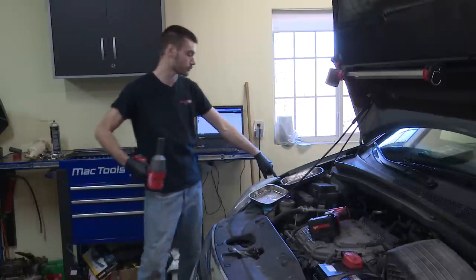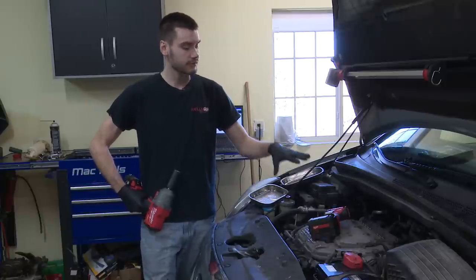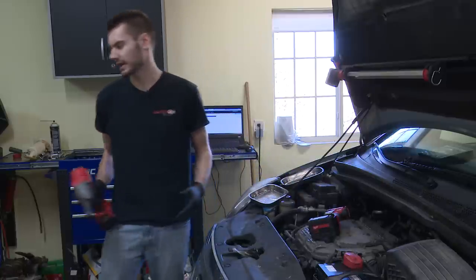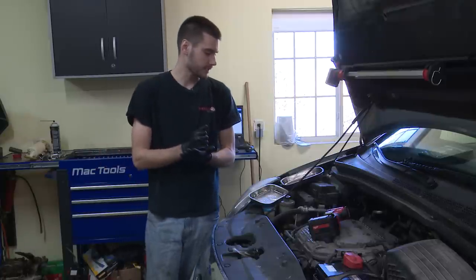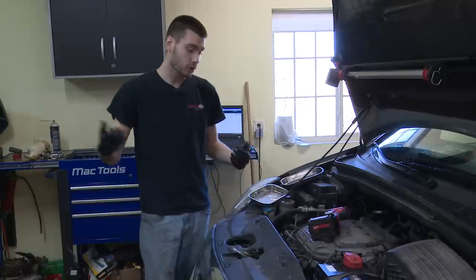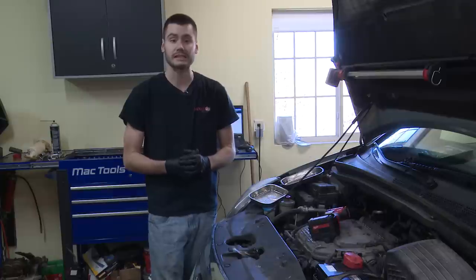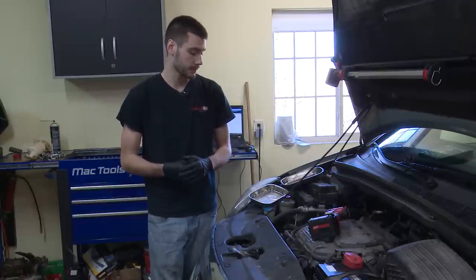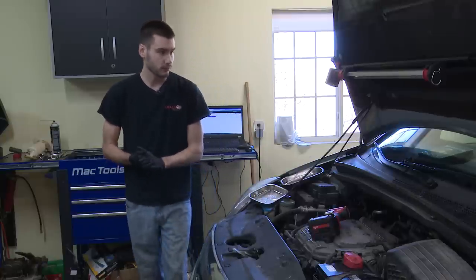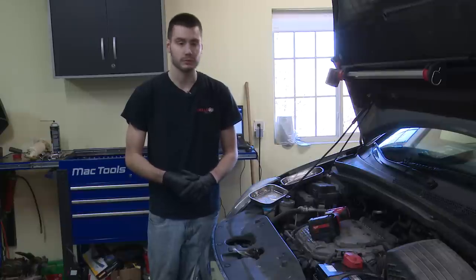We already have the right front wheel off because we need to go through the wheel well to get to the crank pulley — we'll have to spin the engine over by hand to get the camshafts in the proper position for adjustment. We want to adjust the valves when they're not being pushed down by the camshaft, when they're closed — that's when we get the lash gap to measure. Book time for a technician is 4.3 hours. For a DIYer at home with hand tools, expect a weekend. We need to rip the intake manifold off and both valve covers — it's an involved job.